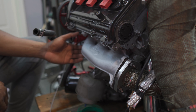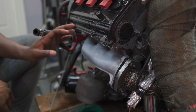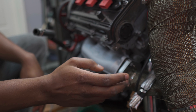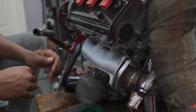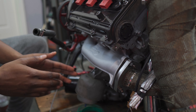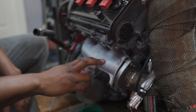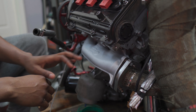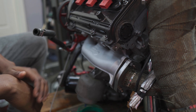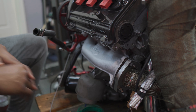We'll kick off the walkthrough with the most essential parts first, and we'll start with our 2.8 exhaust manifolds. These are required for the single turbo kits that use either the Excess Power, the Project B5, or the 034 Motorsports single turbo kits. They all bolt onto these 2.8 manifolds, which makes it super easy. These are easy to find, super cheap, and a great option to get started with. You can find them in either A4 2.8s or Passat 2.8s — they're the exact same.